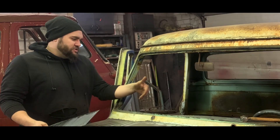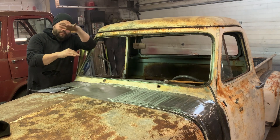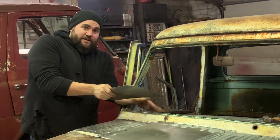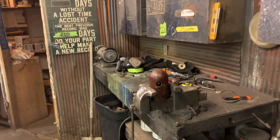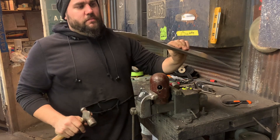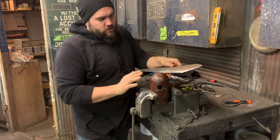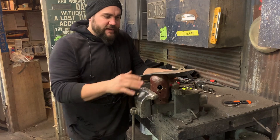So I have a gap in between my dash — the Lincoln dash curves down, and the stock dash is up above where it would be. So I have like a two or three inch gap. What I'm going to do with this piece of metal is actually bend it so that it's flat down here but has some curve to it. The way I'm going to do that is I put a bottle lid in a vise, and I can come over here with a hammer, tap along that edge, and just gradually put a big curve in. It still needs a little bit more — just gradually keep working that over and I can curve it all the way around, or just put a couple inch curve in it like I need.